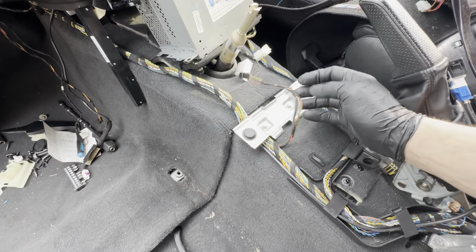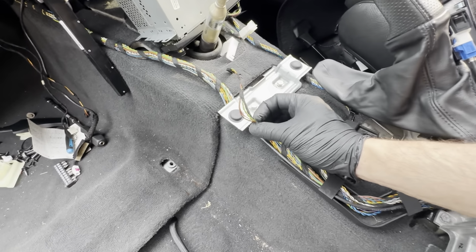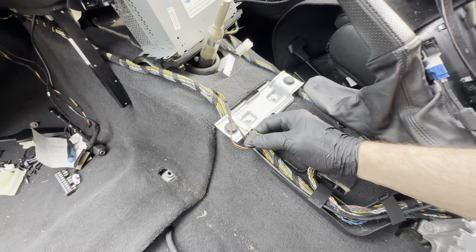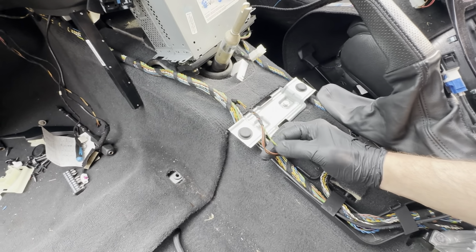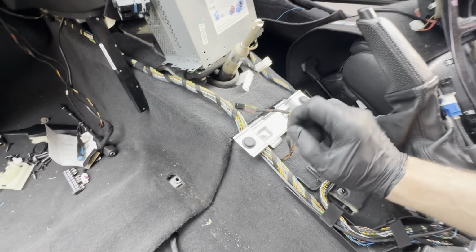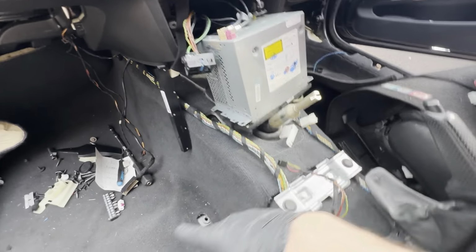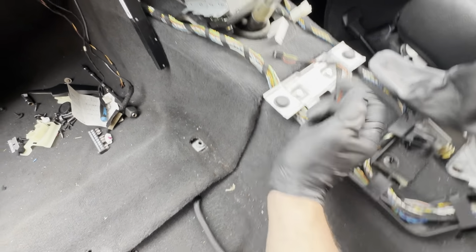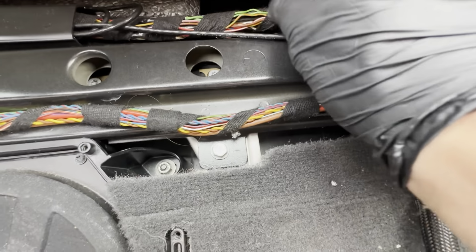So you've got the CAN interface, same as the head unit. So this just taps into any CAN interface that you see anywhere. So you can go directly into there or into there. In my case, I actually caught it somewhere down there because it's all on one loom, and then you just tap these two wires into the loom somewhere here. I think I made the joining somewhere in this area here.